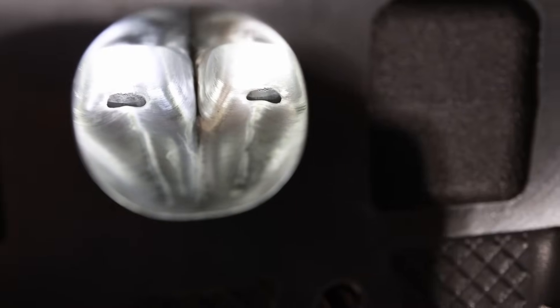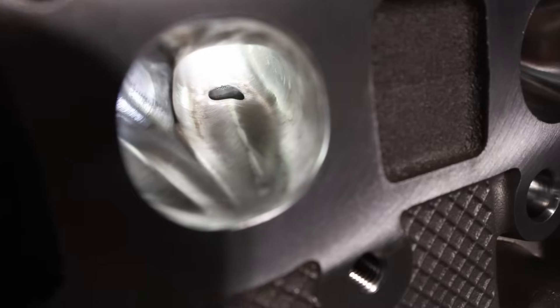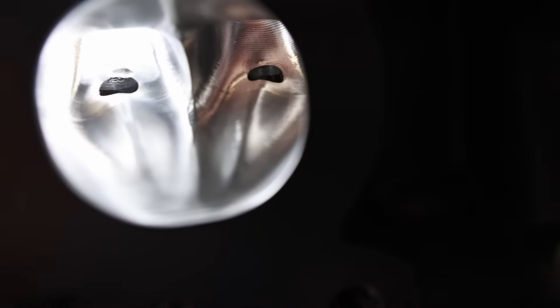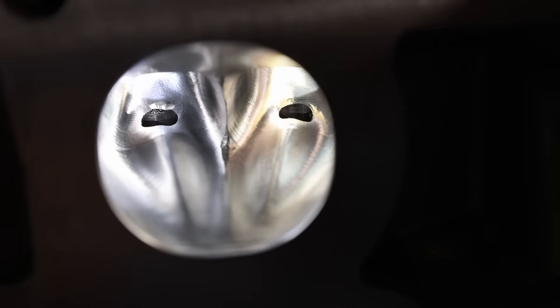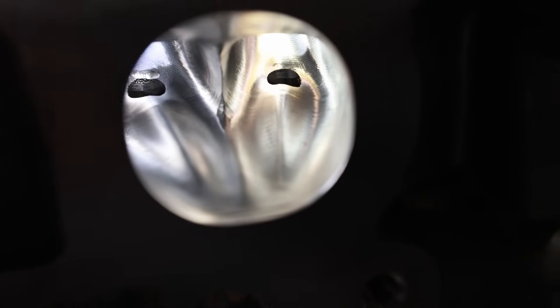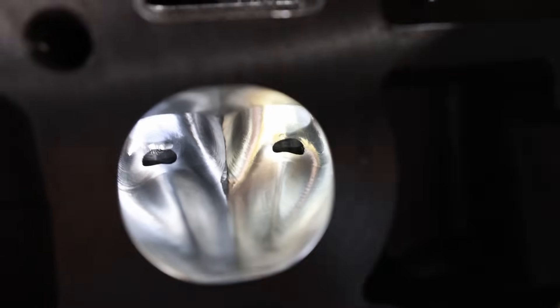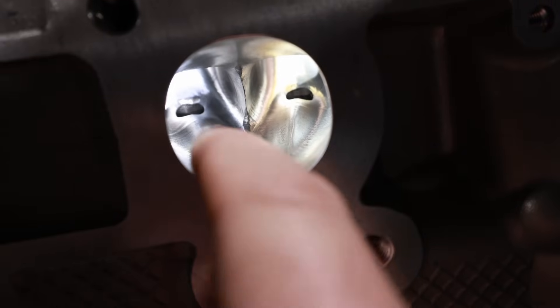So this is the hand port that Matt had to digitize too, and you can see that it only hit the top of the guide bosses — we're going to chalk that up to how it had to digitize it. But here is the hand port, and now here is the CNC port. I think that thing looks delicious. We do have to get rid of the sharp edge on the divider, but besides that this thing is ready for guides and the valve job. It kept all the features — I put a fin up here, a fin on the floor, there's a fin on the roof, and I also made the guide bosses into fins.